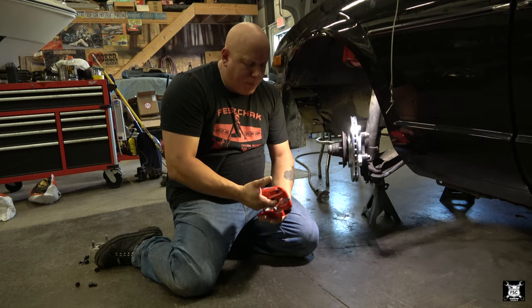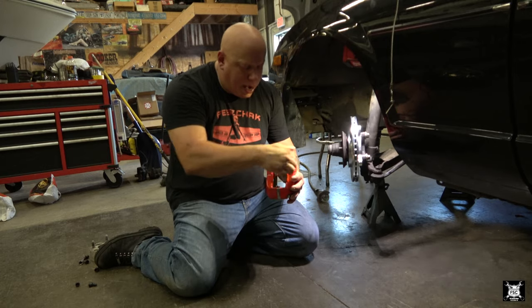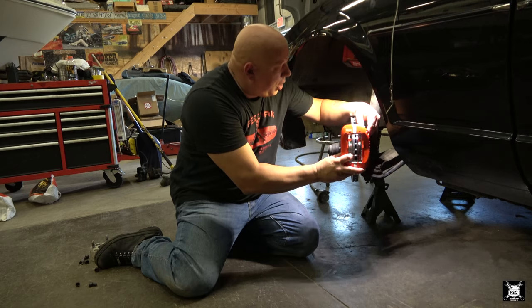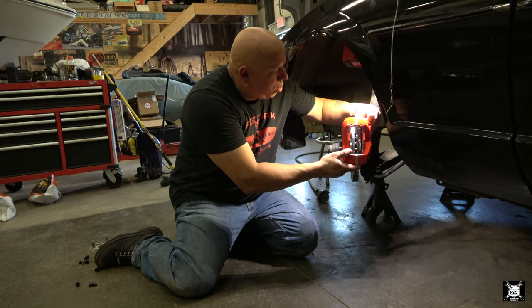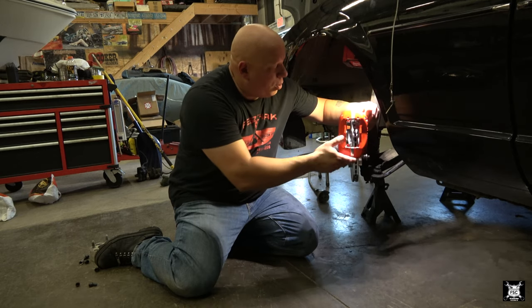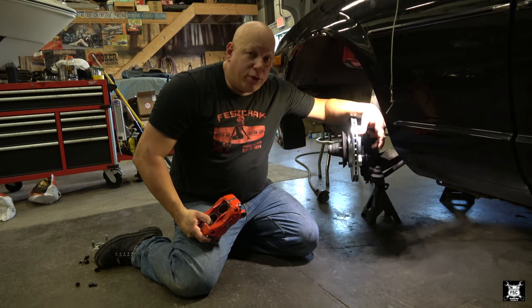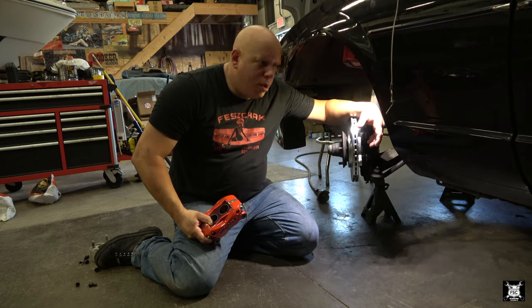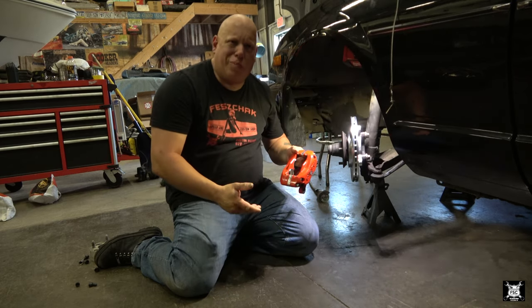Also, you don't have to put the brake pads in before you put them on. You bolt this on and then slide the pads in and then put your cotter pin through. Now, what you do have to worry about is your position on your rotor, in and out. Just like that big brake kit we put on the Chevelle, you have to already shim it or know what you're doing. But with this custom-made aluminum bracket, the work was already done for me. The other side lined up perfectly. However, we did run into a very significant problem, but we found a very simple fix for it. Matt, go ahead and put the caliper on, and then we'll get into the problem.